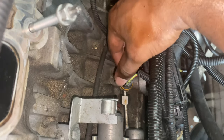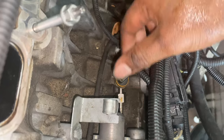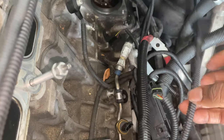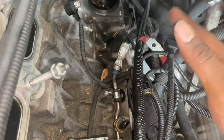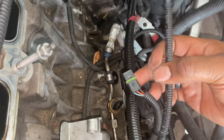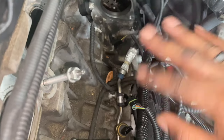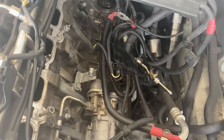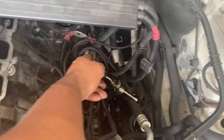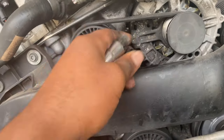This part is staying with the car, so I'll disconnect this and label the wires so I know where they go on reassembly. The thing about BMWs is once everything is in place the wires are just the right length so you can tell exactly where they go — and some connectors only fit that particular socket, so it's pretty hard to confuse where things go. Now I'm going to loosen the tensioner to take the belt off.